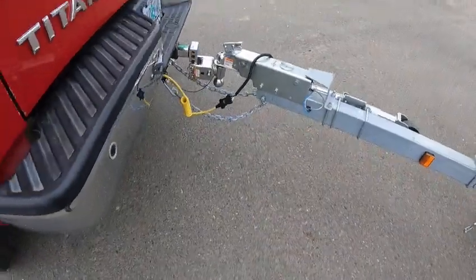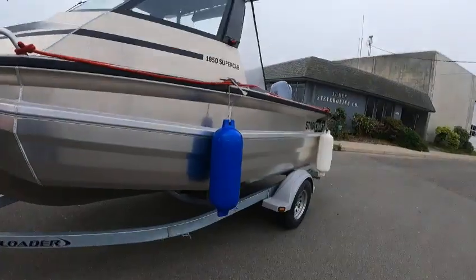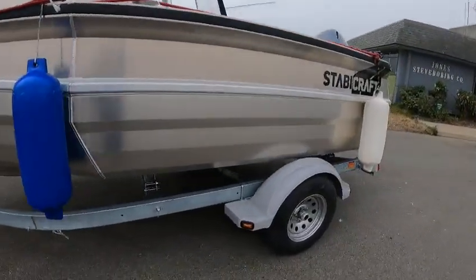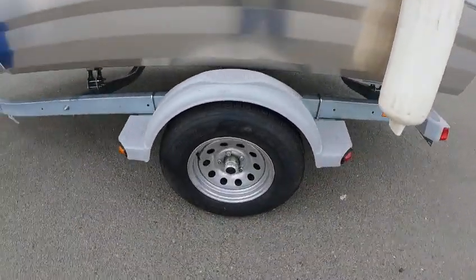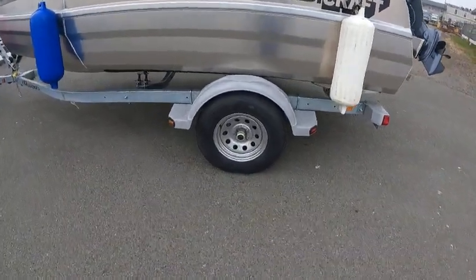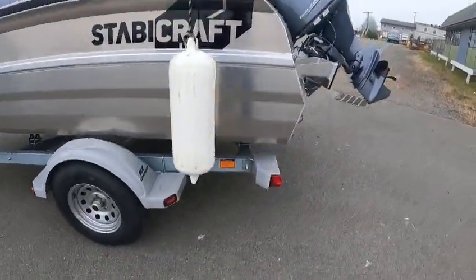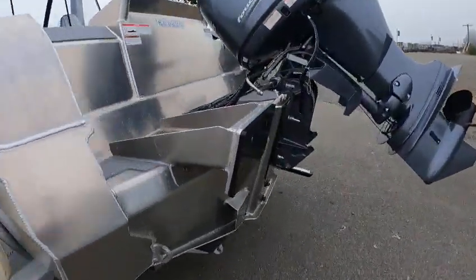Flat four on the trailer wire. Top mount — you're looking at 23 inches from ground up. It's a 1850 Super Cab 2021. You got gear oil hubs — brown good, white bad. ST 215/75R14, 50 pounds, 80 pound torque on the lug nuts. Disc brakes. You got a kicker bracket here — tilt it down.